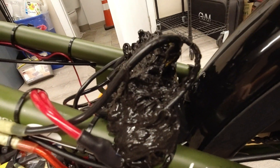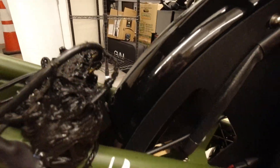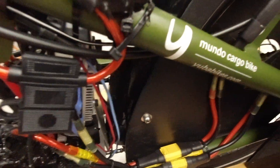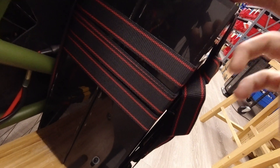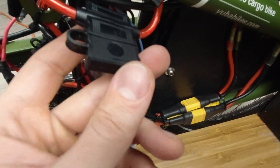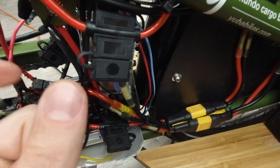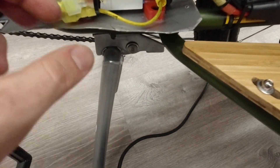This has all been nicely silicone treated. All the batteries have their grounds going to that bus bar, and all the positives are going to a fuse. In addition to every single cell having a fuse and the output having a fuse inside the battery, I put another fuse there anyway just because. These are some nice liquid-resistant fuse holders. So each battery has a fuse on it, and that is then going to two bridge rectifiers here.